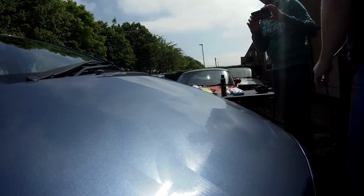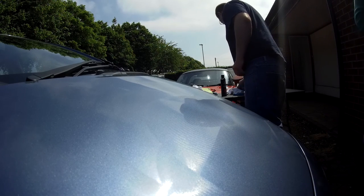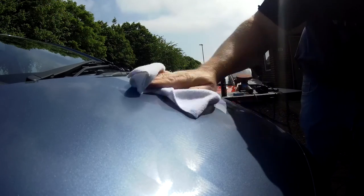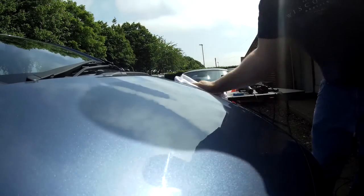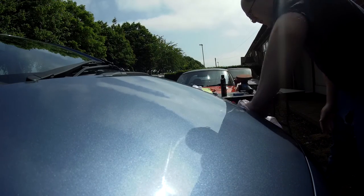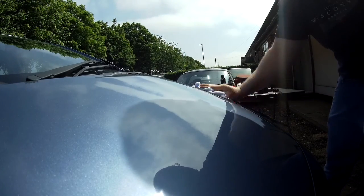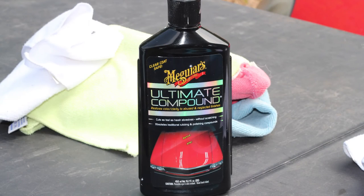You just see how we took it off — you just let it stop rotating. Once it's done, use your microfiber cloths and wipe over the bonnet, and you can see the lovely finish you get. I don't think it'll be obvious from the photos, but the scratches are pretty much gone. If you get right up there and feel it with your fingernails you can feel the deep part of the scratches, but you can't see that horrible surface scratching that was there before.